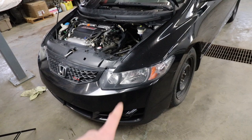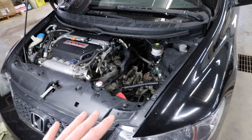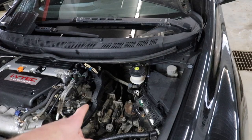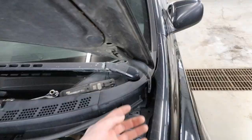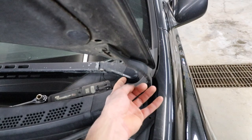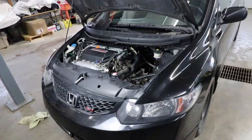Once we get the front of the car jacked up and the front bumper off, we can see how we're going to mock up the intercooler piping. With the car higher up I won't be slouched over trying to reach the exhaust manifold on the back of the engine, and I can get underneath to reach any bolts. To get the wipers off, pop the two little plastic covers with a pick, pop the wipers off, pop the wiper cowl off — that should give us more access.